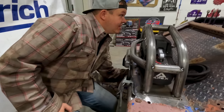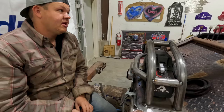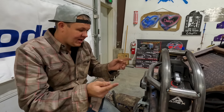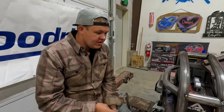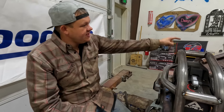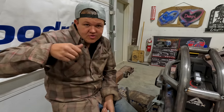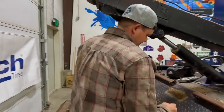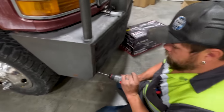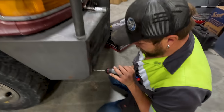In one of the last episodes we built these little cages — we didn't weld them out, so I'm going to take the time and weld them out. Hillbilly has already welded the two side ones fully off camera. Once he's done with the front bumper getting all the matting off, we'll switch — he's going to run the idle-up cable. We're taking a 15-foot cable from the back of the bed and running it up to the throttle. When you screw it out, it idles the engine up so you can run your hydraulics at a higher idle.